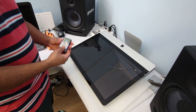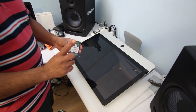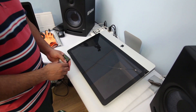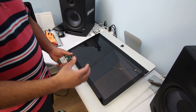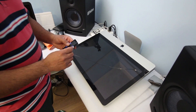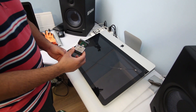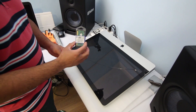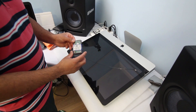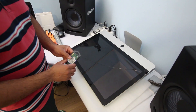Also, in the second part of this video I'm going to show you that this Mac is capable of handling 8 GB of RAM in one slot. It has four slots, so in total it can go up to 32 GB — this is the mid 2011 model. Officially on the Apple website it states up to 16 GB, 4 GB per slot, but reading Mac forums I found it can handle 8 GB per slot, totalling 32 GB. I'll make a part two video covering that RAM upgrade, so stay tuned.